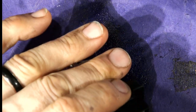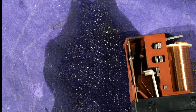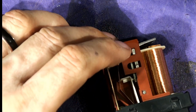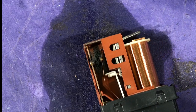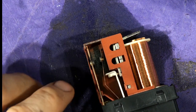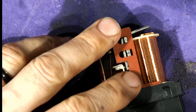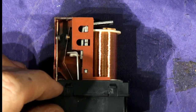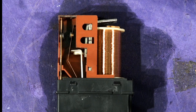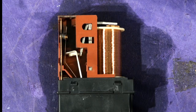Finally give it a bit of a blast with brake spray cleaner — don't run them in there — just give it a bit of a washout. That'll dry out now. Put the mains back on the relay coil. It was the bottom set of contacts that wasn't working — check meter's working still. There you go. Right, bottom set — are they working now? Yeah, it's working now. Yeah!